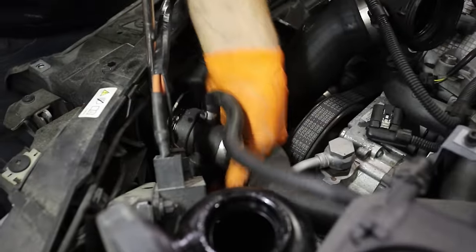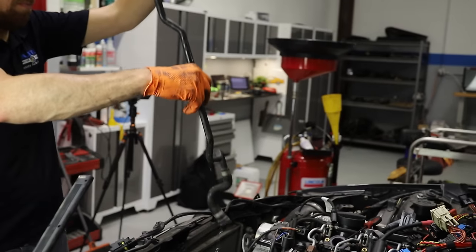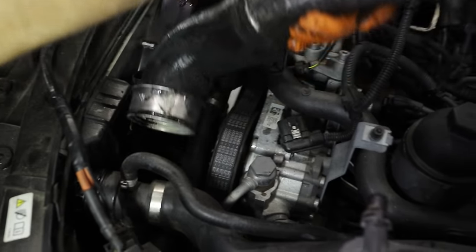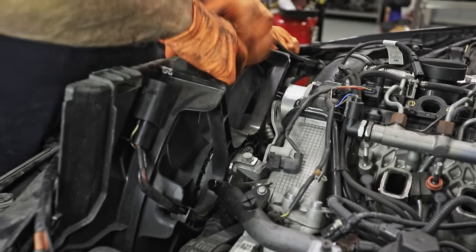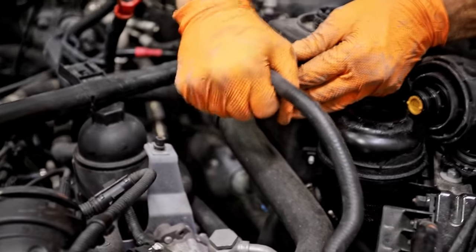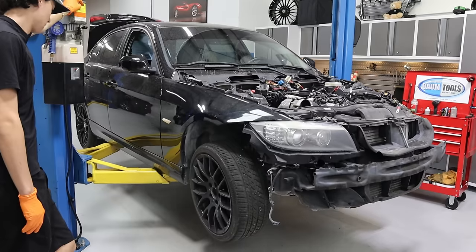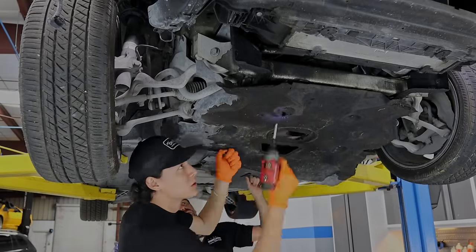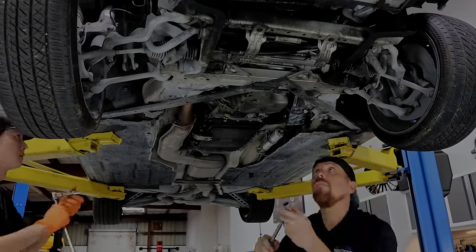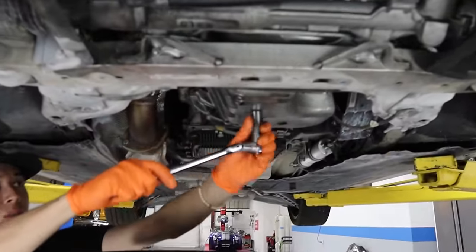Anytime you remove the engine, you want to make sure you're removing all the hoses, clamps, fittings, and everything around the engine to make as much room as possible — like the coolant hoses, the charge pipe, the electric fan. I'm trying to keep everything intact and save as much as possible, because if one car has a good part and one has a bad part, obviously we're going to use the better part. Now we're putting the car in the air. We've disassembled as much as we can from the top and now we're going to pull the panels down and start working from the bottom, trying to avoid bringing the car up and down as many times as possible to work efficiently.